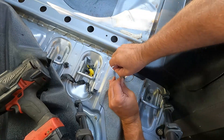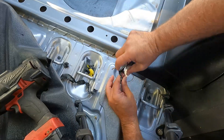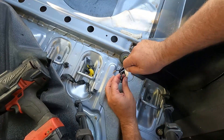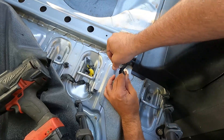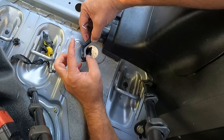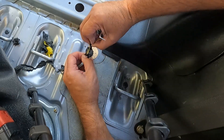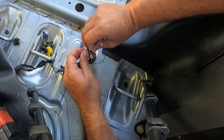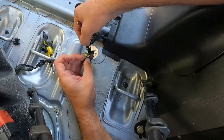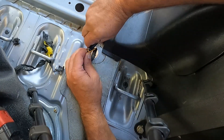If I would have done a little bit better visual inspection, I wouldn't have replaced that sensor. But sometimes you just go with what you think — in my case I was wrong. Part of the reason I jumped at that is the part was so inexpensive. So we have a yellow with a red stripe and then a white with a red stripe. The rest of these wires look okay — wait, take that back. Found another broken wire in here, and I bet that has to do with our EVAP. Let's pull this back a little farther and get all this fixed.